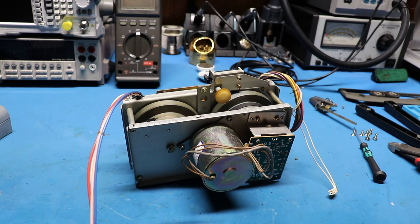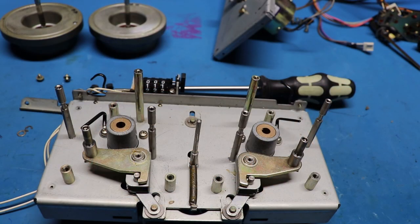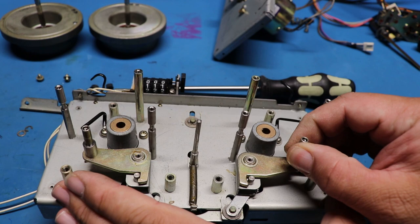Went ahead and got the transport almost all the way apart. One thing when taking these apart - and I always tell this to people working on these - take plenty of pictures as you're taking it apart. Remember where the C-clips go and where the washers go, because I always see people screw these up and lose the washers or C-clips, or they don't put it back together properly and of course it doesn't work. There is a service manual that gives you a breakdown of how everything goes back together, but if you take pictures it's much easier - you can refer back and just reverse the way you took it apart.